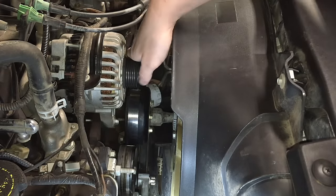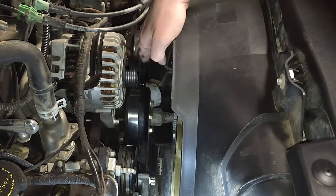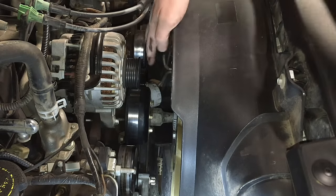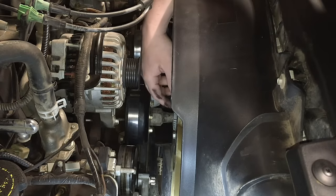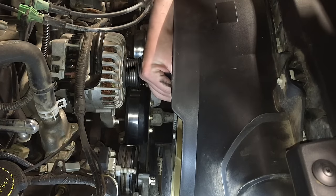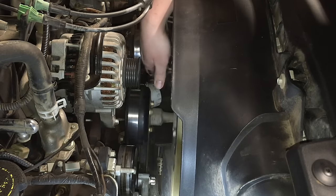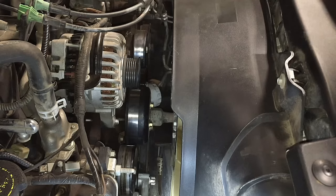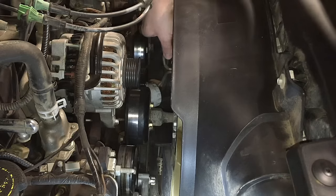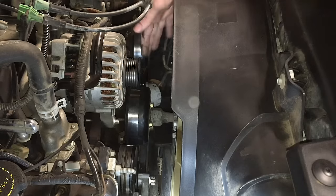The alternator is often mistaken as being bad. The bearings inside the alternator may squeak when you spin it at a lower speed — that is totally normal. For your coolant pump pulley, grab the fan and tug up and down to test the bearings inside, then spin it to test the water pump bearings as well. But the big thing is all these idler pulleys — you want to really check them and make sure there's no noise or roughness. They're very common on the 5.4 and 4.6.